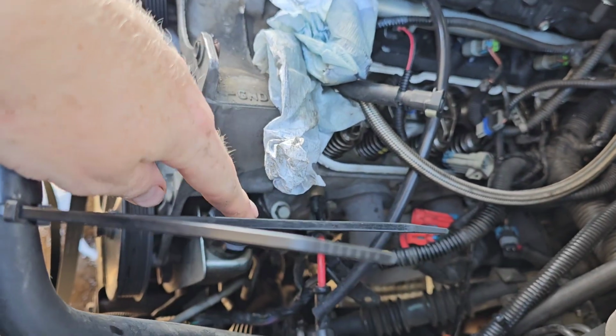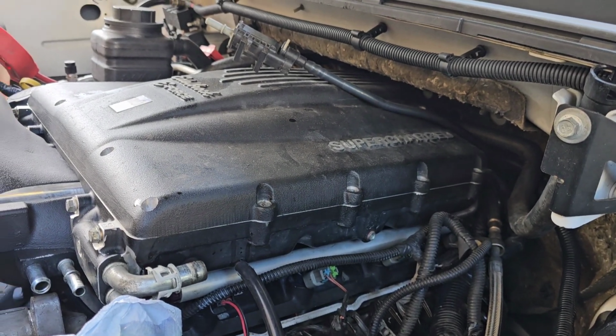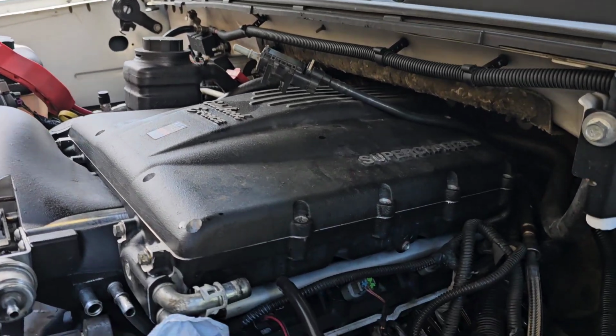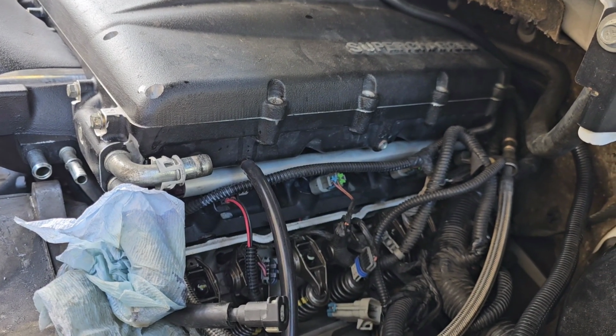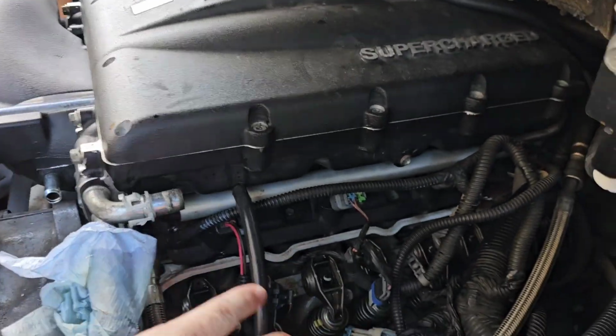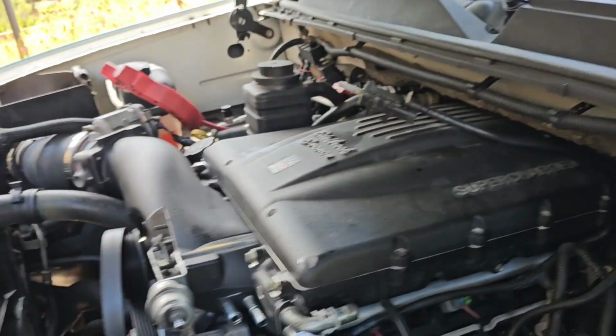So I'm going to go ahead and pull plug number 1 here. I'll get top dead center, compression stroke, and the torque sequence on this half just to verify, because I got one when they put the DOD into the top end. That one right there looks like it's crooked, so maybe I'll get lucky, and if any of them are majorly out of torque or loose, I'll reset everything, put it back together, and try it again and see if that fixes the problem. Hoping, but I'm doubting that's going to be that easy, but here we go.